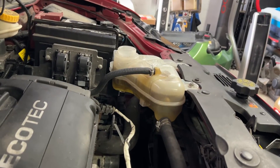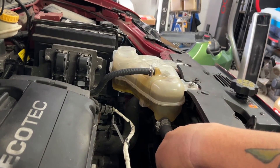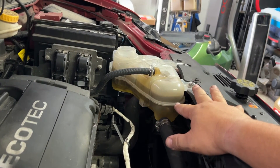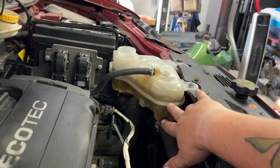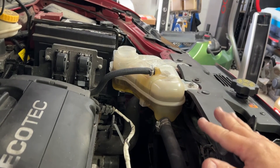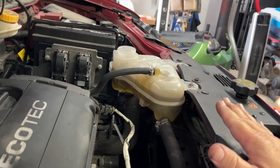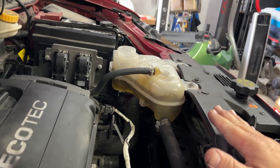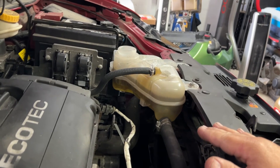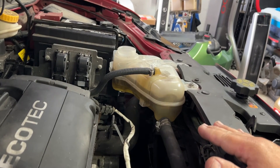It's starting to warm up, hoses are getting warm, and you can see that we still have air bubbles coming through. It's settling back down to where it should be. Once everything gets hot we'll shut it down, let it cool off, close the cap, and then let it sit for about 30 to 40 minutes before starting the process over.